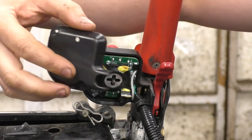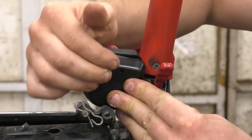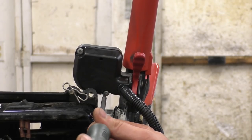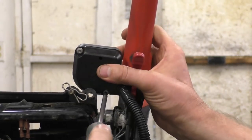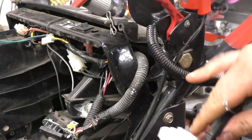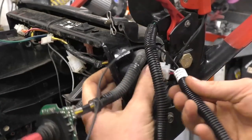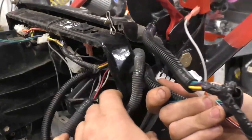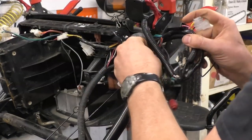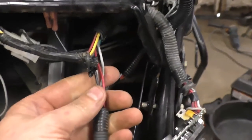The cover will go in this position — it's going to slide right into the grommet on the wiring harness. Line it all up, then get those two screws in and tighten them up evenly. Now run the harness behind where the old one was; it's going to be a bit tight and you want to run all the connectors behind there as well. It probably looks like a huge mess of wires on camera, but if you're doing this at home it's not too hard.